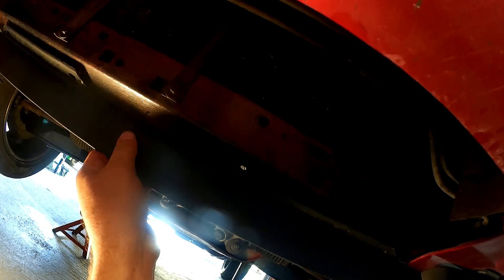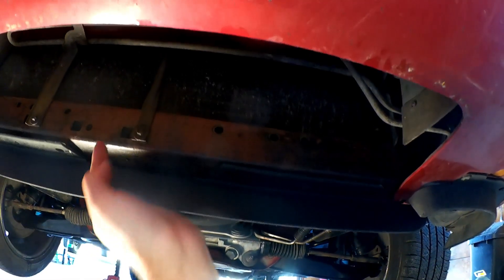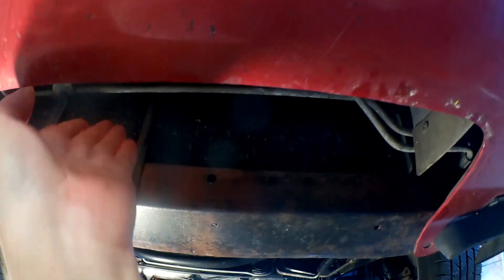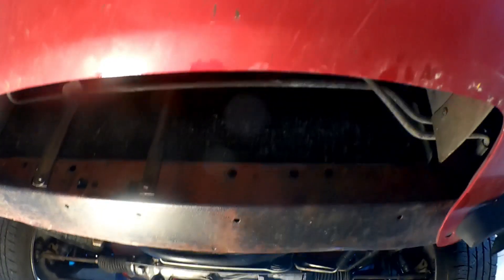This air dam may not look like it does a whole lot, but keep in mind — you don't get a job as an engineer for an automaker if you're a dummy. You've got to be pretty sharp if you're an engineer at a car manufacturer, and they don't put anything on the car that doesn't have a return on investment. If they made a million of these cars and this part cost a dollar each and they left it off, they could have saved a million dollars. This thing lives right here, and its job is to smooth out air that goes underneath the car and direct more air up, because this is one of your major intakes for cooling air. A lot of air comes up this way and goes through the radiator. The air dam creates more pressure in front of it and less pressure behind it, so more air gets pulled through the radiator — meaning more cooling.